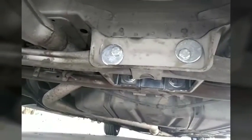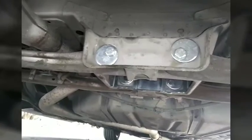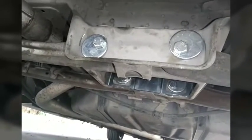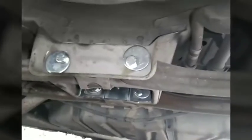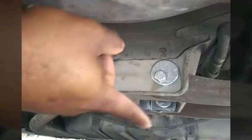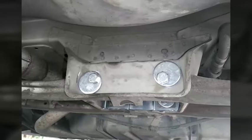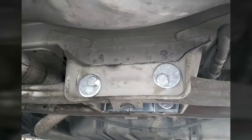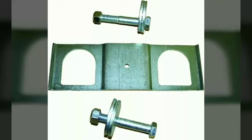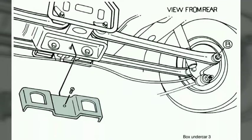As you can see, the setup in the back — I've got a camber kit here and another one back there. You see the plate? Basically all I had to do was unbolt the factory bolts right here and drop the trailing arms. Then I had to get a drill — the kit comes with a template showing how far you need to drill. This is the alignment kit. It requires you to install two new bolts with washers and a backing plate. You're going to need two of them: one for camber and one for toe, plus some cutting required.